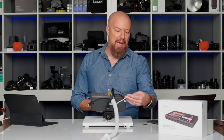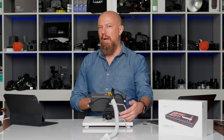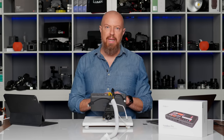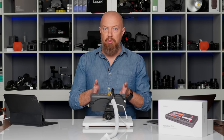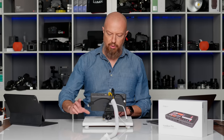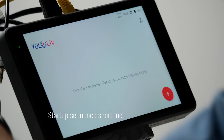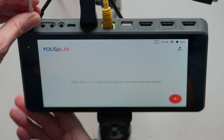The next thing I want to plug in is power. Here's a little tip — this is something that's been kind of an issue with these boxes from the beginning. It has a battery built in; you charge this over USB. The problem is that if the device is fully charged and plugged in and you go to power it on, it won't power on. You will need to unplug it from the power source and then power it on, then plug the USB back in. So remember: unplug your power first if it's fully charged. Press and hold the power button on the bottom. Now I'll plug the power back in to keep it charged.